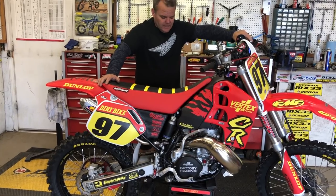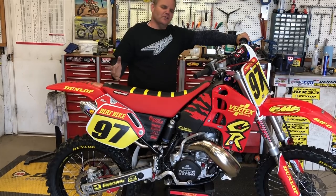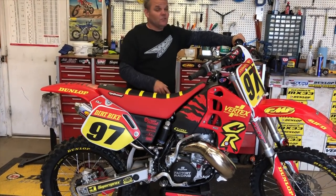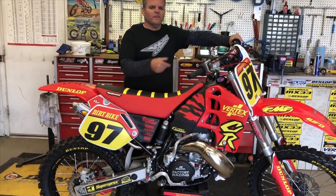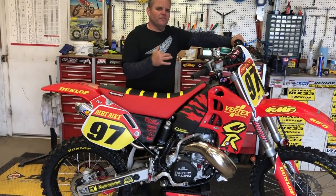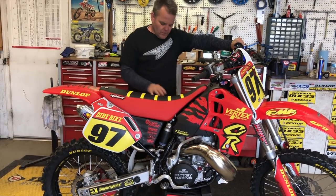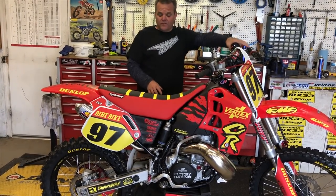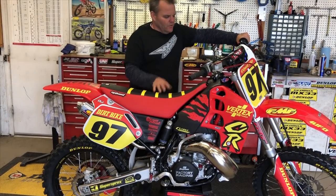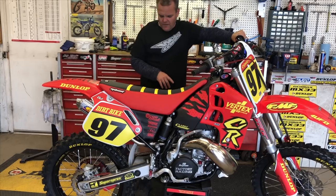500s are gnarly — not for me for sure — but they're kind of a novelty thing and guys are getting more into these. This one was so bad that the lower frame cradles had eaten through, so we actually took it to a Harley guy who does frame fixing and he fixed those pieces. So when you're looking for a used two-stroke to fix up, really look that frame over carefully so you don't have to do any of that and waste time and money.